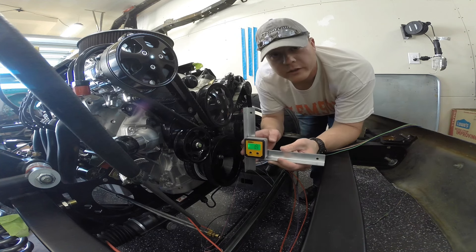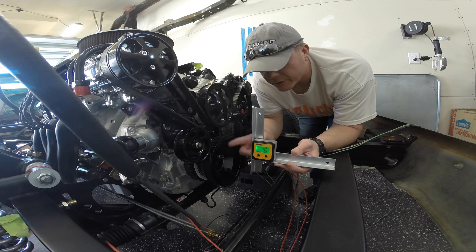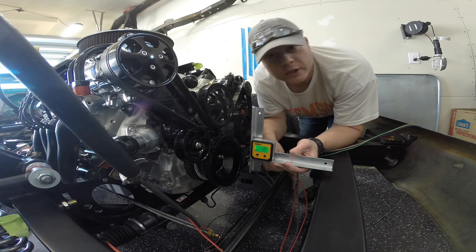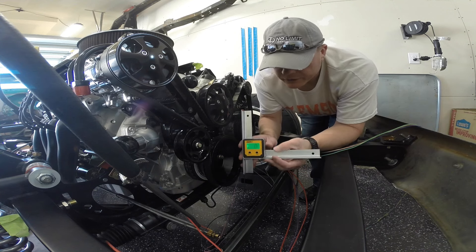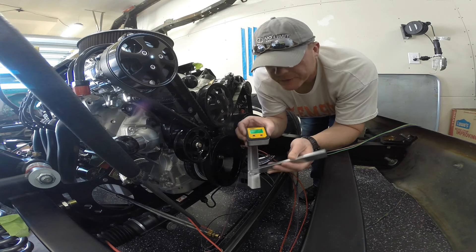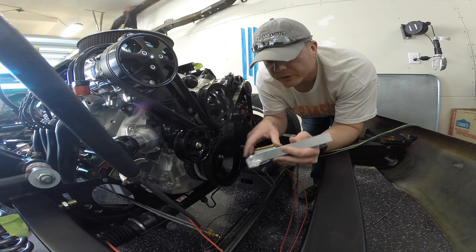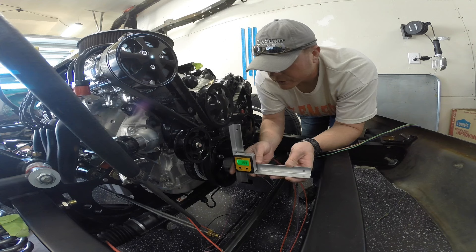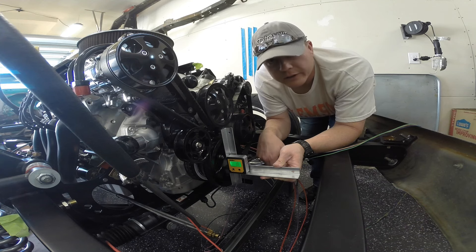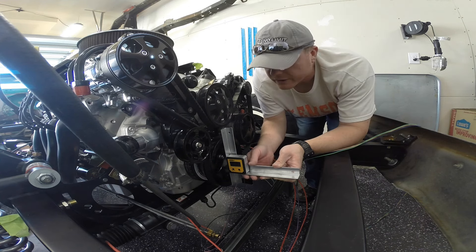The first measurement is the engine/transmission angle, and we're going to use the crank pulley to do that. You need a nice flat pulley that doesn't wobble — the face should be perpendicular to the crankshaft line. I've got a standard angle finder from a big box store, and a small fixture I made from two pieces of angle iron welded together, which is handy for this type of measurement. I just set this on the pulley, wait for a stabilized reading, and jot it down. In this case I've got 3.5 degrees.